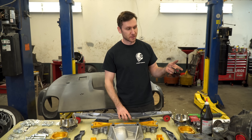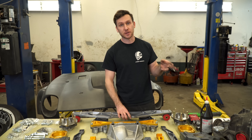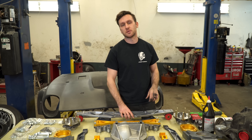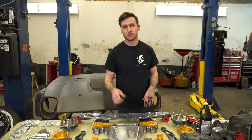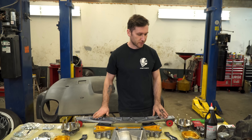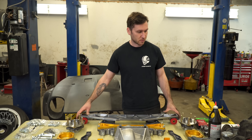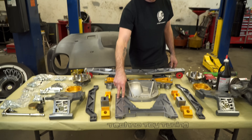This particular diff is out of a 2011 Ford Explorer. There's a couple different gear ratio options available. I went with a 3.73 — it's a little bit lower than my 4.10 that was in my R200. I think that's going to suit this better, which is like one of the main reasons I went with this kit. Also, just freshening up the rear end — the power brace.